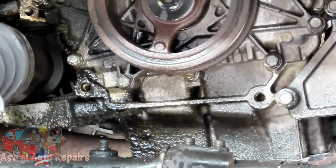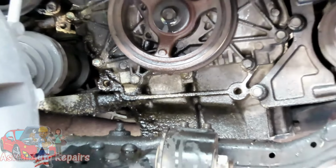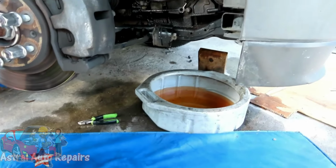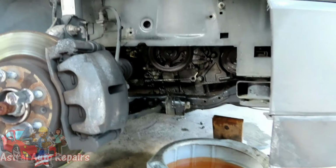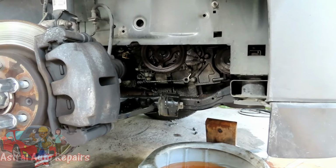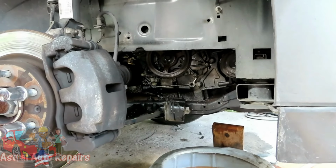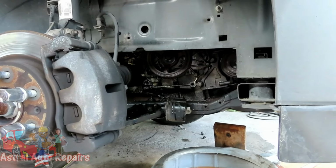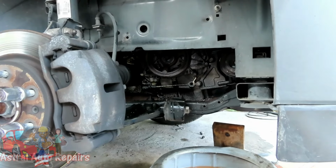Now, guys, I'm getting on a mat and I'm laying down looking up under there. Guys, you have to make sure you have a nice solid jack stand and leave your hydraulic jack up under there. And a good little tip is, when you got the tire off, stick your tire up under there. Everything you see, some bricks. Use the neighbor's. Use the neighbor's kids.